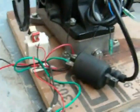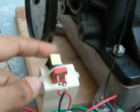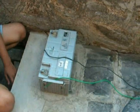From here you can see the coils and transistor. Magnets are placed on this wheel and the coil picks up the pulse. This pulse is given to the transistor, and the transistor drives the bigger coil and gives the spark.